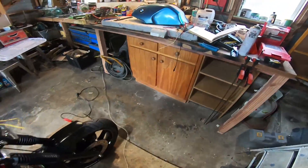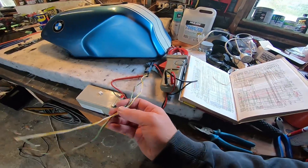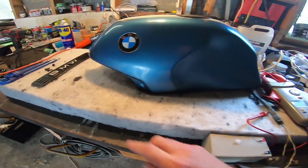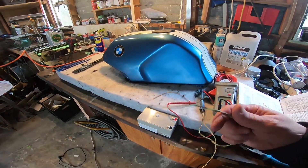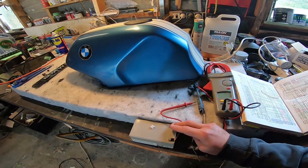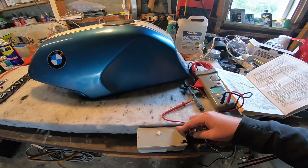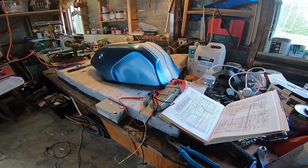The other one I'm working on is the fuel pump, which is slightly different to my tank. His bike's fuel pump wires in at this point here. We've figured out that these two cables are our fuel pump and we can chuck them on this little battery to confirm — and yes, the fuel pump's running, so we'll connect those ones in and go from there.